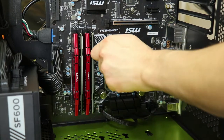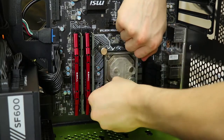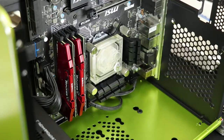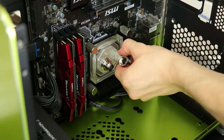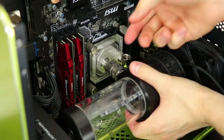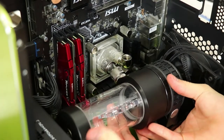Now this is a connection I've had to make in quite a few cases. Generally I mount the pump right in front of the CPU block and create a short run of tubing between the two. But since the tolerances are so tight for this connection, the CPU block needs rotating to be able to create that straight link. It was close, but such a slight offset that not even a couple of 45-degree angle adapters could do the trick. These are the sort of things that will never be apparent on a first build — getting a sense of depth compared to water cooling hardware is very hard to predict, especially on small-scale builds. If you have a connection so tight you have no room for maneuverability, preparing both sides of a connection prior to connecting them and then forcing the two together with a stubby length of tubing can get you through some tight situations.